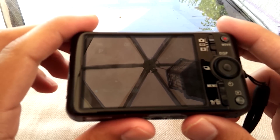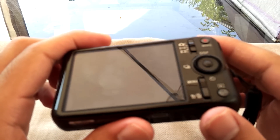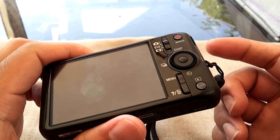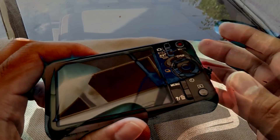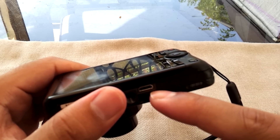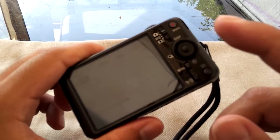Now for pros and cons not listed elsewhere online. This camera records video in MTS file format at 60 frames per second. VLC media player doesn't handle 60fps well — it caps at 30 for some reason — however Windows Media Player on Vista, 7, and Windows 8 plays it just fine with no additional codecs needed. Pictures are saved as JPEG. One important con: you cannot take pictures or record video while the camera is charging. Once plugged in — whether to a computer or a wall outlet — it will not allow recording.